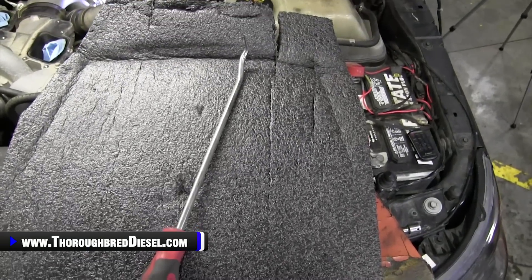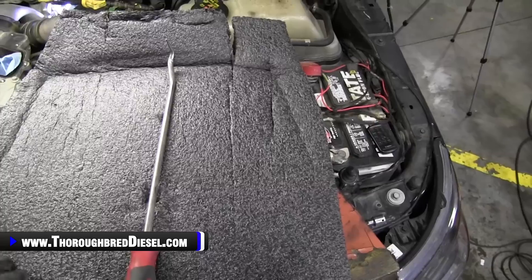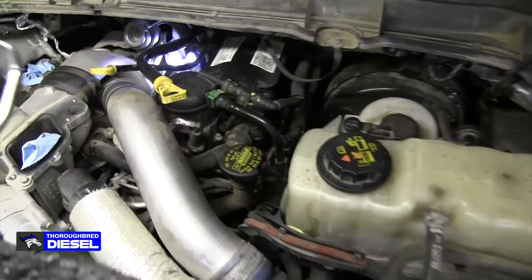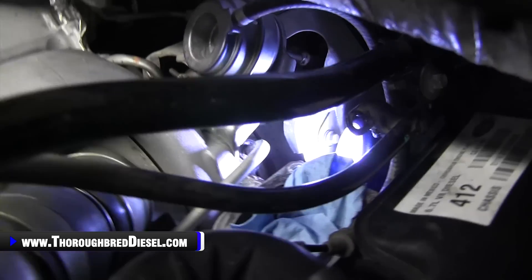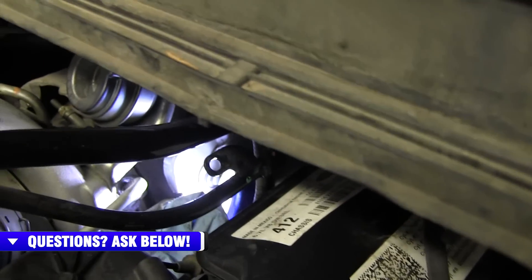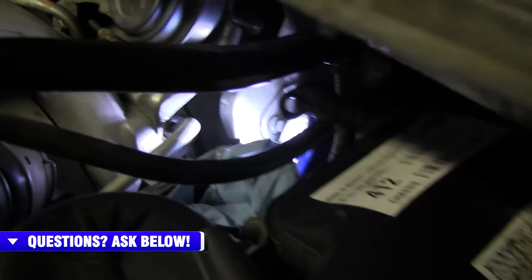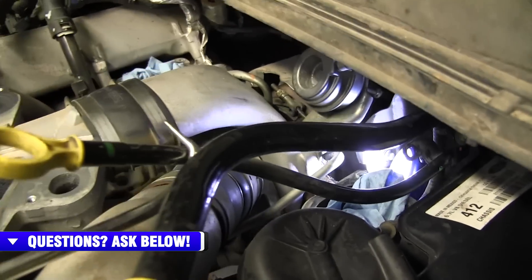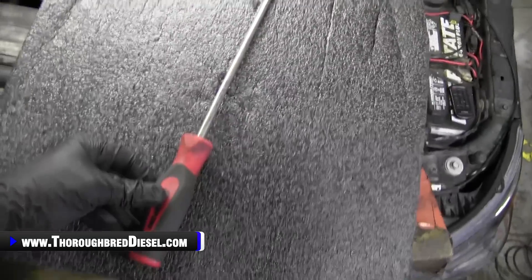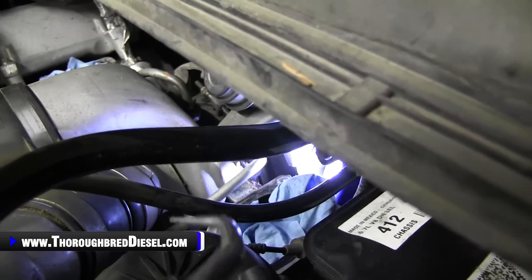Before we start our installation of the coolant fitting on our turbo for the 6.7, we drained the coolant out of the main radiator, out of the primary coolant system. That just got a little bit of coolant out and gave us less of a mess to deal with. One of the most difficult parts of working on this fitting is the transmission and engine oil dipstick — they're right in your way. But if you've got the right tools, you can get around it. This hook here — you can get one just about anywhere; this happens to be a Snap-on longer reach hook. You can put it between the two dipsticks and get the safety cover off of the fitting.